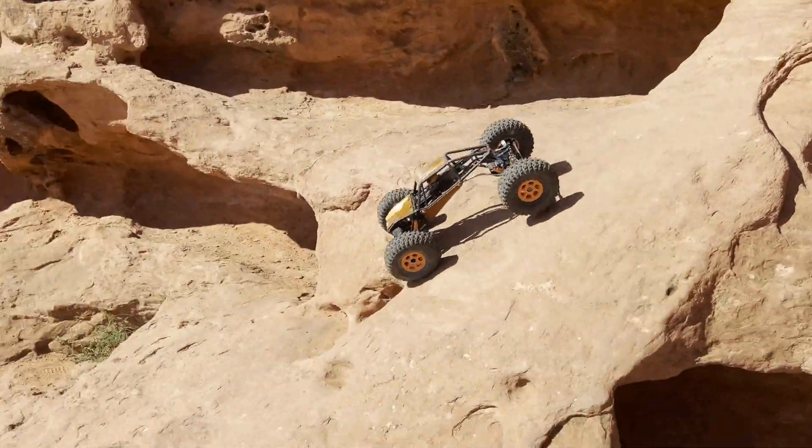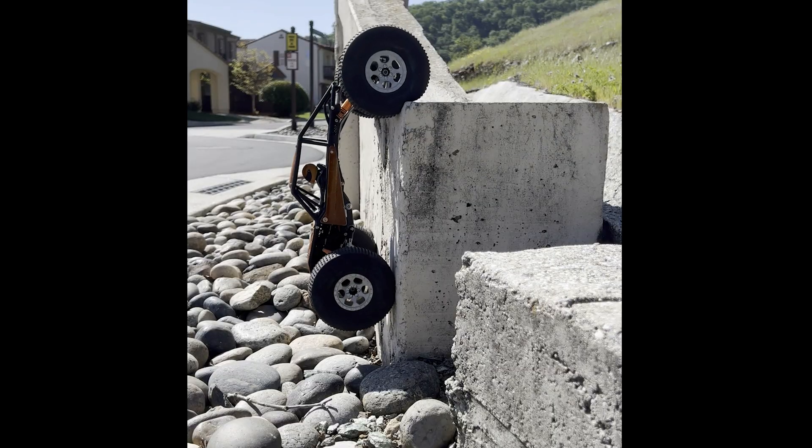In a different video, I will explain high-speed tuning for trucks, buggies, and other fast-moving vehicles that hit jumps and bumps at speed. The only exceptions I can think of on a slow-moving crawler are maybe a throttle bump, run-outs, or my personal favorite — a death drop. Of course, damping isn't just high-speed or low-speed only. There's a transitional zone between the two. It's not binary; in reality, it's blended.